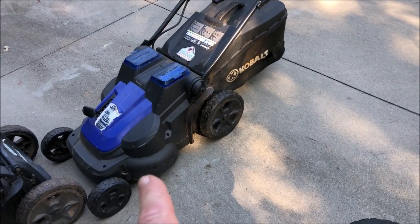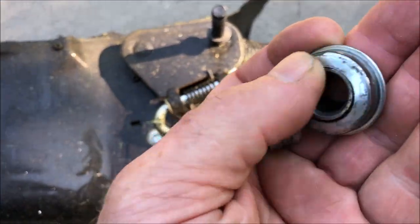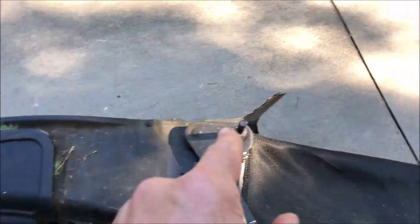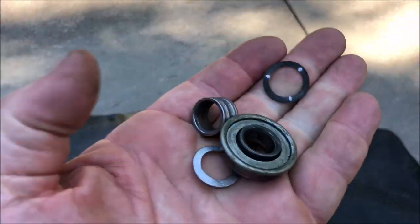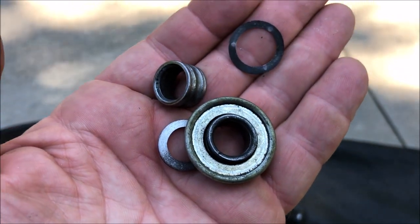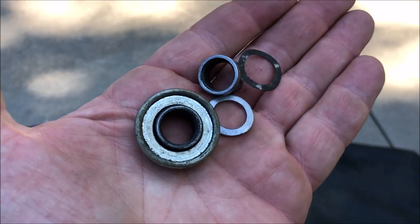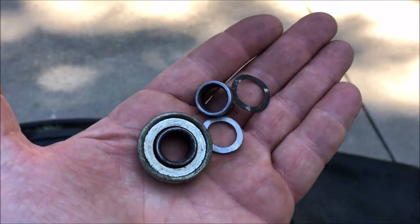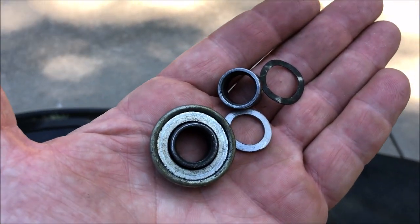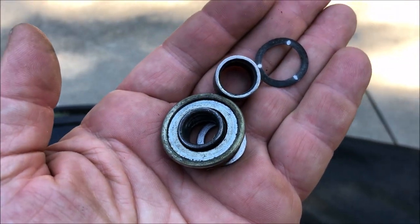You can see that these bearings are all junk material. With all the weight of this mower and people pushing it hard into the ground, it's putting a lot of load on them. And if you get any moisture in there — because people tend to use these in wet conditions — these bearings are going to fail. I had one fail and repaired it, but it wasn't perfect. The other wheel just came off after mowing just a portion of the yard. So after measuring, I found some bearings that can be pressed into the wheels and will actually work better than the original junk.